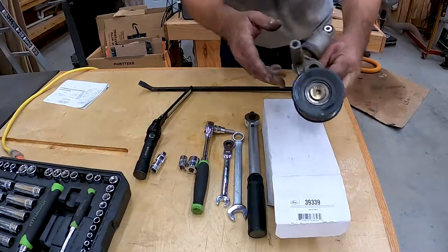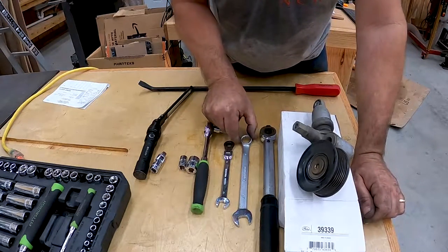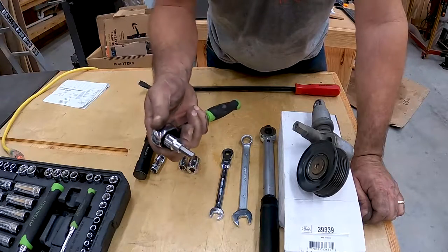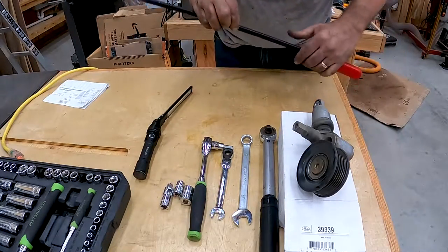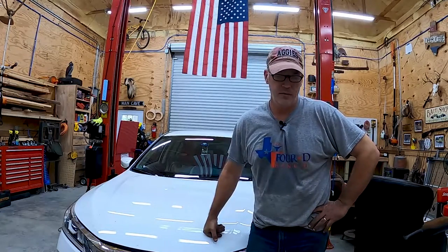Here are the parts I used: the pulley assembly, Gates part number 39339. Tools used: a 17 millimeter fork wrench, 17 millimeter box-end wrench, 12 millimeter box-end or combination wrench, an 8 millimeter hex key, a swivel, a pry bar, and a flashlight or two. That's going to do it for the repair on my daughter's 2017 Honda Accord — thing sounds real quiet now. We fixed the belt tensioner; it only took about an hour with a few common tools. Anybody could do this in their driveway or garage — not a hard project at all. If you found some useful information, consider subscribing and give me a like. Thanks for watching.